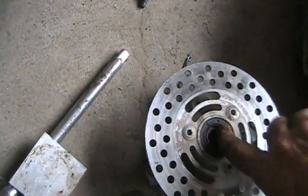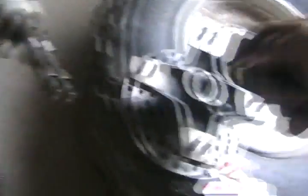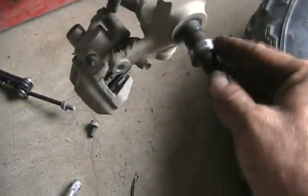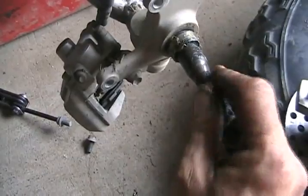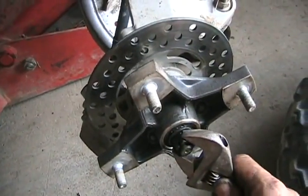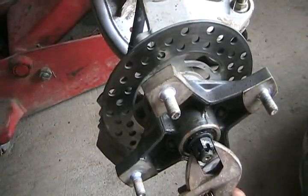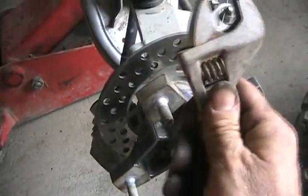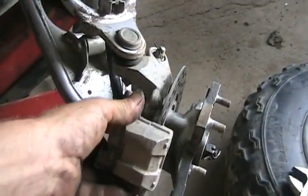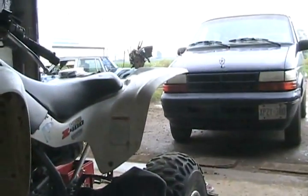The seals you can just push in with a socket too. Some grease as I mentioned before - grease on these little sealing discs that slide on, grease on the axle shaft, and we're ready for reassembly. You don't have to make these very tight - the thing that sets the bearing tightness is actually the spacer between the two bearings. Under-tightening is bad, over-tightening is bad - just a little bit of hand pressure until the cotter key lines up. Just bolt the caliper back on, put the wheel on, and you're done. Just have to do the other side and we're ready to rock and ride.